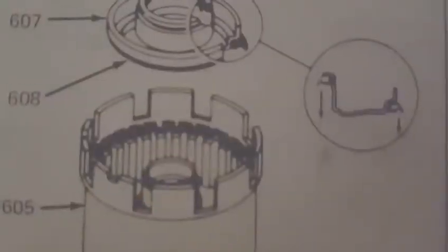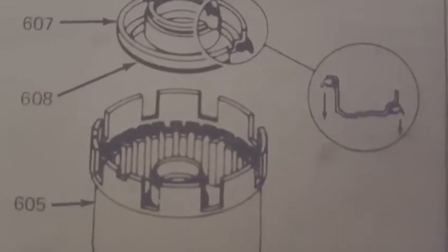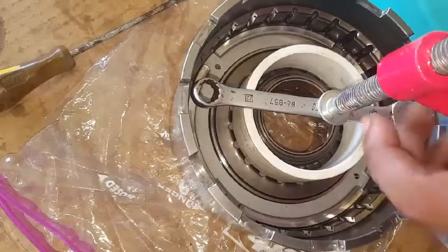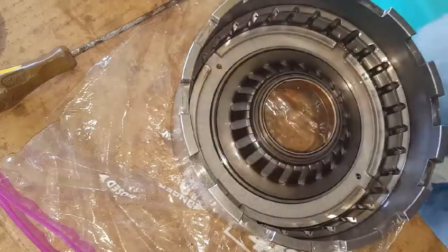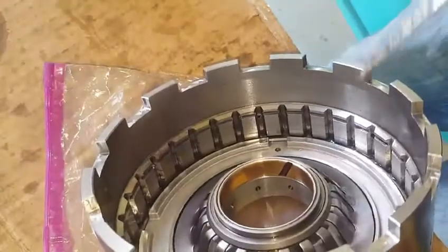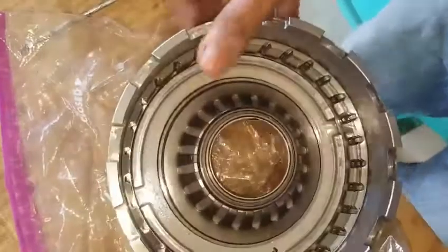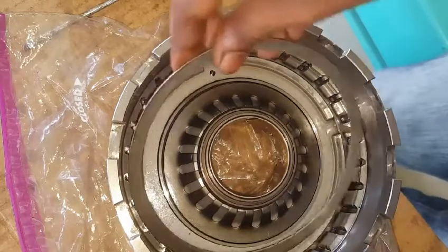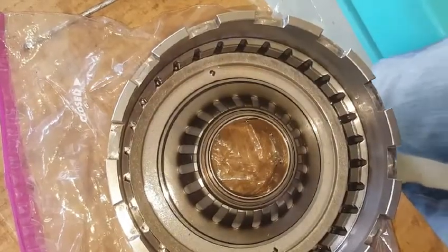This is the position of the lip seal where the two arrows are pointing down for sealing the piston in its chamber. With the C-clip retaining the piston spring, it is now time to remove the C-clip compression tool and check that C-clip for a secure fixture in its groove.